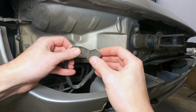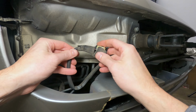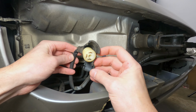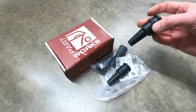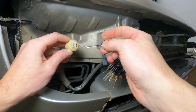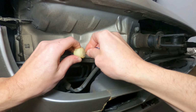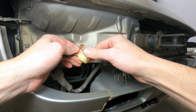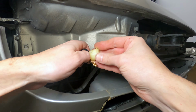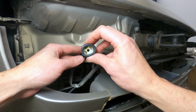In this case, I'm going to be replacing the protective rubber boots on the left and right turn signal wiring harness connectors, as they tend to crumble with age. Again, another part that is only available as aftermarket. I got these from Partworks in Germany, and I'll include a link to those in the description. In order to replace the boot, you'll need to use a terminal extractor tool to push the pins out of the plastic connector so that it can be removed, slip the new boot onto the wiring harness, and reinsert the terminals into the connector. With the new rubber boot installed, the wiring will have some additional protection from the elements and future corrosion.